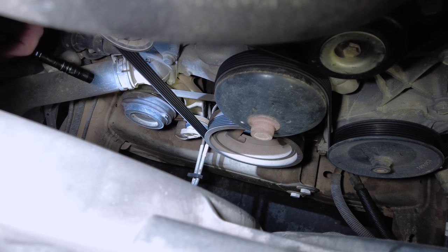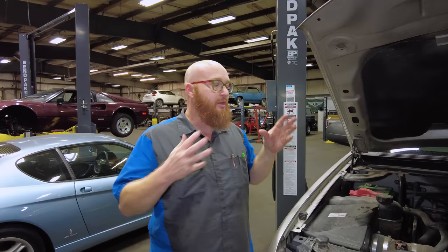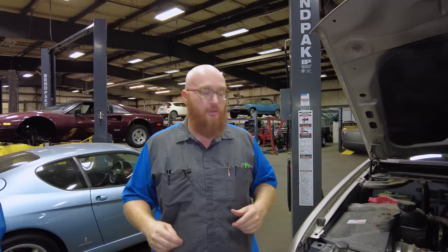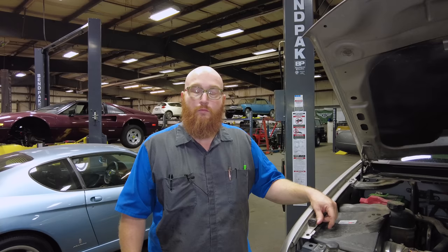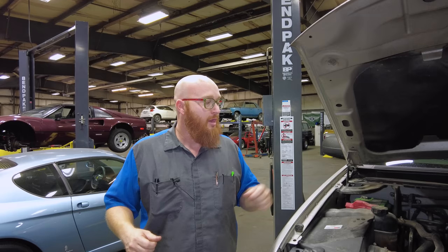Here you can see the AC compressor, and the small serpentine belt already has cracks with a little tensioner pulley there — it will break. Typically the little tensioner pulley seizes up and throws the belt, and your AC quits blowing cold. You can budget for that — luckily it's not a full AC system replacement, just a pulley and a belt. In newer models they went to a stretch belt and did away with the tensioner altogether, which pretty much solved the problem. But these older ones with their own separate tensioner have a very high failure rate.